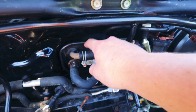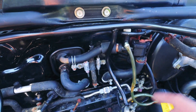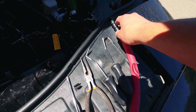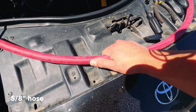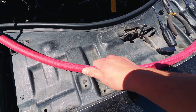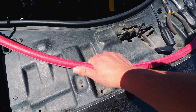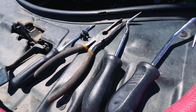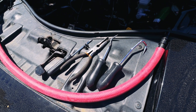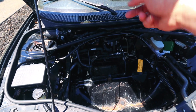So today we're actually going to connect these two hoses to create a loop that bypasses the heater core and we can still bleed it from here. I went to the auto parts store, got a couple of couplers and some hose just in case I need it. They didn't have black — I'm not super crazy about putting a red hose up front but that's just an aesthetic thing. I got a couple of hose hooks, a screwdriver, and some pliers, so hopefully without too much trouble we can remove those hoses, loop it, and finish getting the heater core out.